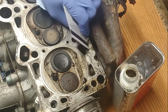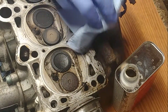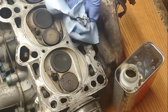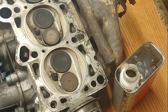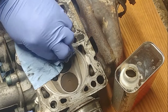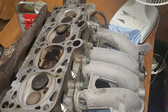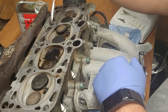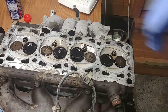That simple card from your grocery chain, gas station, or any old plastic credit or debit card is perfect for this application. During cleaning and wiping, make sure none of those debris and dirt get into those oil and cooling passages. Be careful. Keep cleaning — that's where the important part is. Our valves are closed and we're working through each chamber.